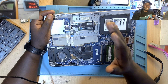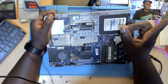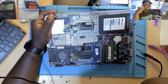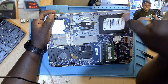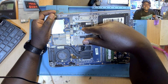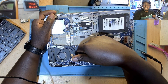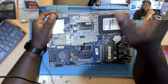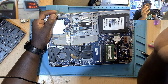In all laptops I've found, if the machine is partially working — like the keyboard backlit is working, the fan is spinning, but there's no display — if it's not the screen, screens are not cheap. If it's not the screen, you're dealing with the BIOS, or sometimes the RAM, sometimes needing a new RAM or even a new port, sometimes even the processor. Partially working laptops are always more challenging.